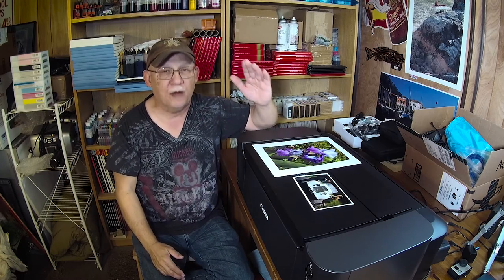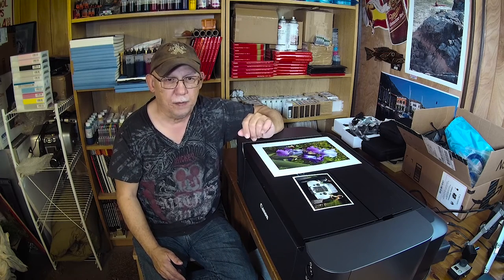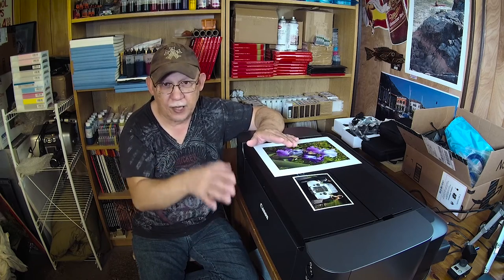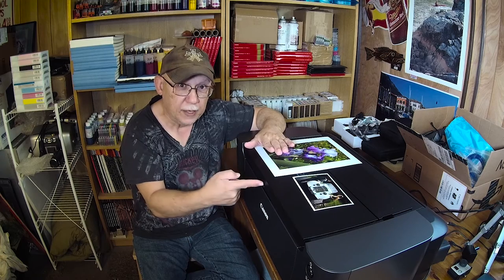In the beginning you will do a purge cycle every time you change a card. Get yourself a second set — spend that $115, or find someone with a Pro 100 or Pro 10 and see if you can get a set of empties from them. They're very hard to find, even on eBay. Once you accumulate two complete sets, slowly begin replacing the originals with PC ink until you have two full sets running. At that point get into the good habit of replacing a complete set at a time. Don't remove complete sets when they're OEM-filled — that's a waste of ink.